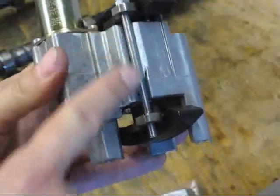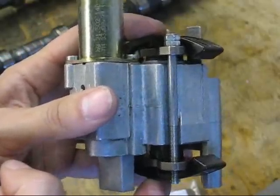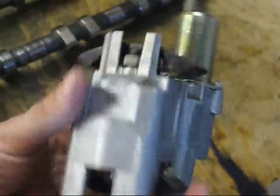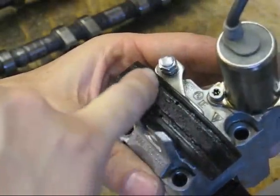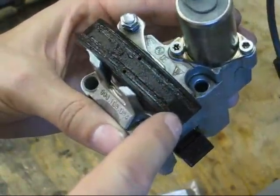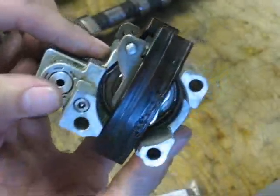I've got a left-hand screw installed which is holding these two slide rails together in the tensioning element so that it can be removed and installed. What I'm most interested in looking at here are the actual slide rails themselves — these are pretty worn. You can see the grooves that have been cut into the slide rails from many miles of use, one on the top and one on the bottom.